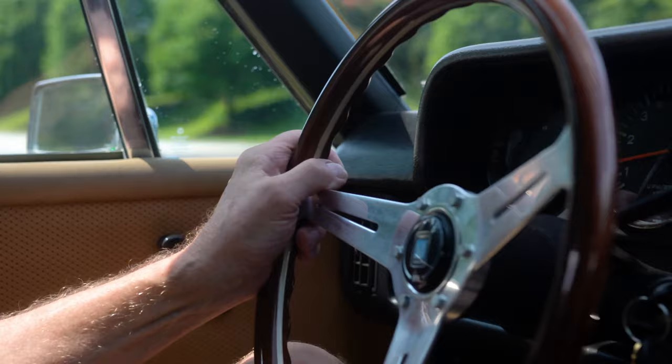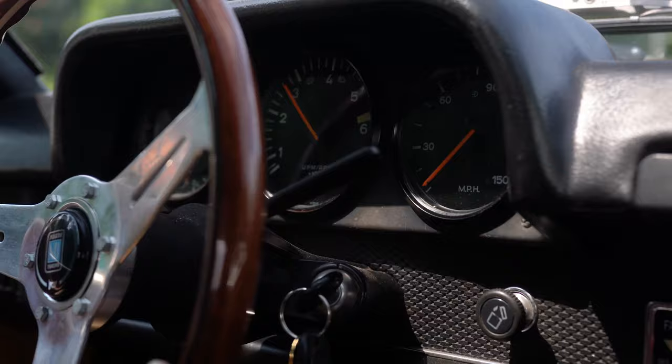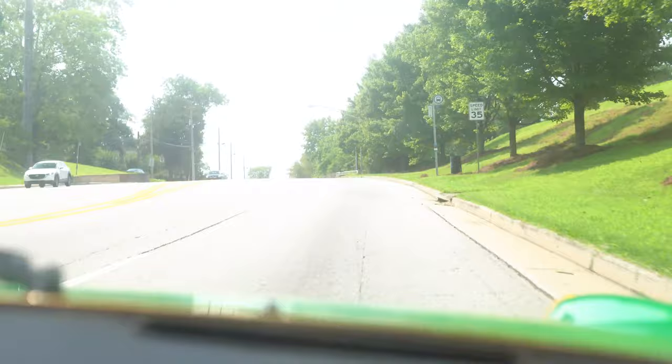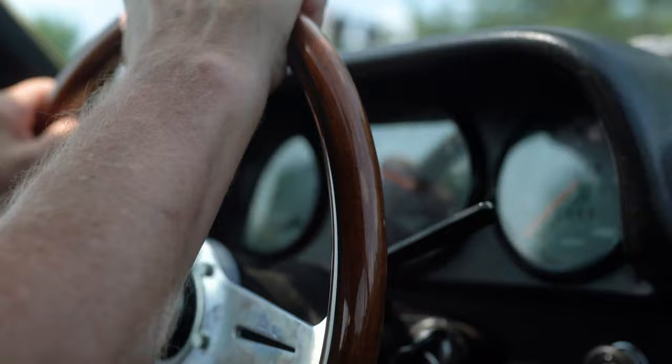At the stoplight I see it's idling a little high — should idle at 950 RPM, but that can be adjusted. Going through all the gears, they're very, very smooth, which means the transmission is in excellent shape. If it grinds into any gear while upshifting or downshifting with correct clutch adjustment, you have a transmission problem — very expensive to address. I can tell this car has KYBs because it bumps down the road; those KYB shocks are very harsh, great for racing or driving hard in the mountains but not good for general 914 driving.